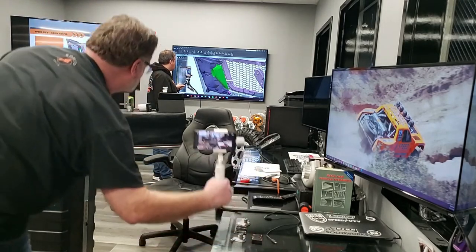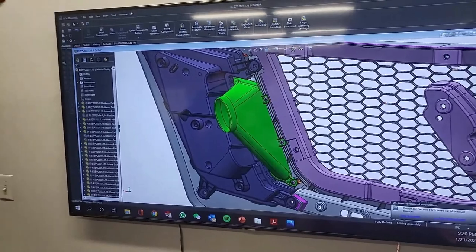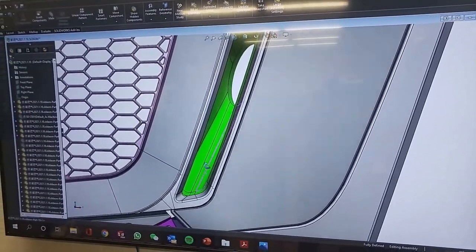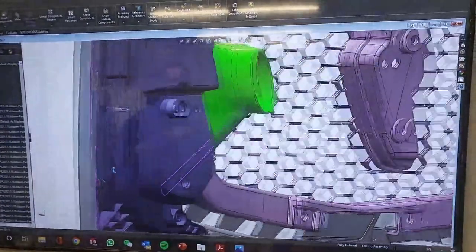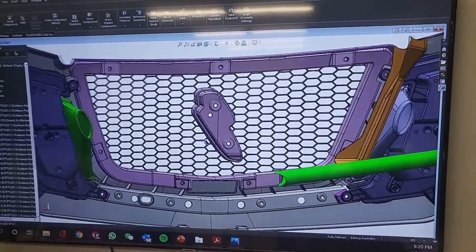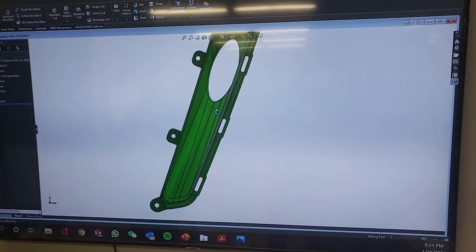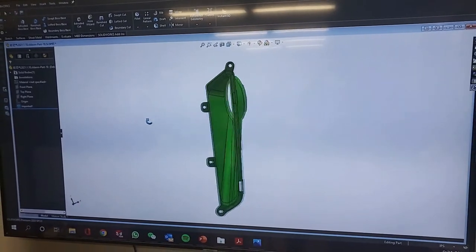There are reverse ducts inside the grill. There is the duct work for fresh air - and remember, this is out in front of the tires, so there's no dust in this section. It'll ram the air into the power steering cooler. Then you would be able to duct it back outside the car, or flip a lever into the car to let the hot air come into the openings inside your dash. So there is AC duct work vents inside your dash. In the four-seater, it does have two ducts that go back to the back seats.